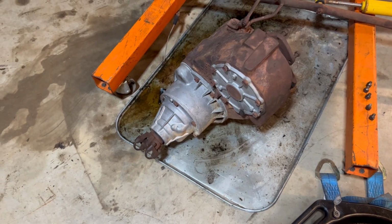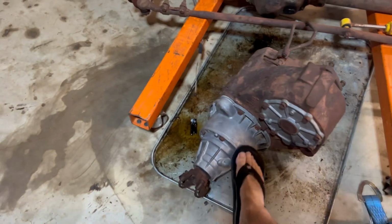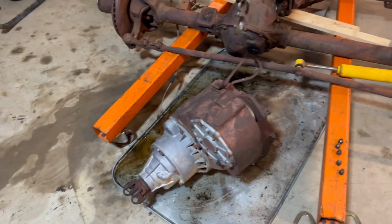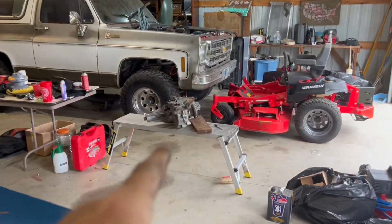And then also, for that bearing to get oiled correctly, I've got to put it in four-wheel drive constantly, every couple hundred miles. I don't want to mess with that. There's a reason they make upgrades. GM spent millions of dollars on this stuff, there's a reason they made upgrades. They went from that to that, and that's what I want to do.